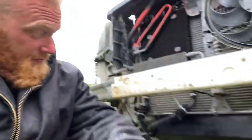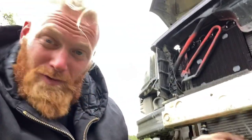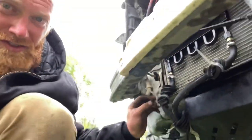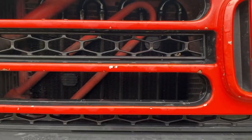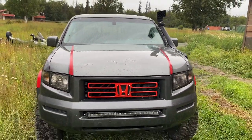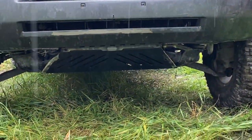So what I did to protect these hoses — I actually took my old strut, cut the rubber off of it, and used that rubber around each one of these areas. Then I just zip-tied it. Should keep it from rubbing, keep it protected, and I think it's going to look way good once that's done. Time to put on the bumper cover and grill, and we're done. Looks pretty good in there, tucked away nicely. Got the skid plate on — turned out nice.